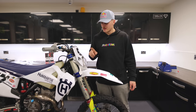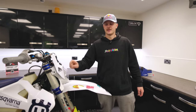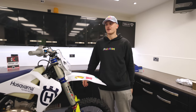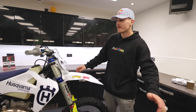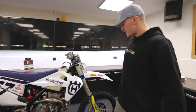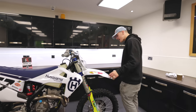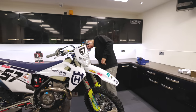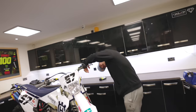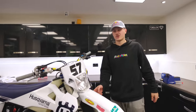For actual races, something quite cool - the headlight is actually fake. If you look closely at one of my Super Enduro race bikes, it's not that it makes much difference, but if you like looking closely. When I was a kid I used to look closely at everything. If you've got eagle eyes, lock on the front of my bike. WP Xplor forks - or cone valves if you're old school. The label is actually still on this one: Super Enduro, 4.7 springs. I don't think that's classified information - well, it probably is a little bit. 4.7 springs, which is quite heavy.